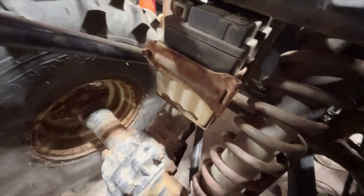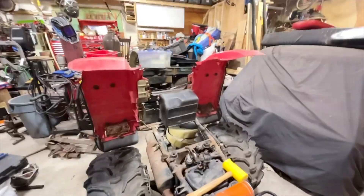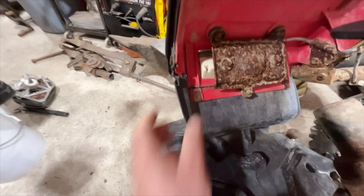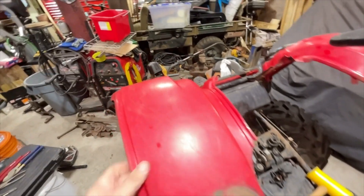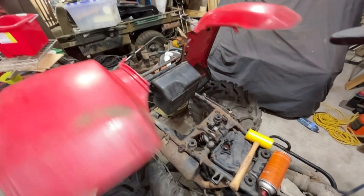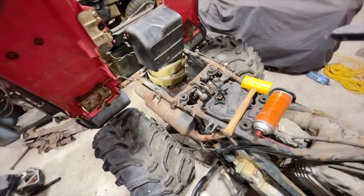Here's the battery section right here. First things first, what I'm gonna do — seeing as I don't need any parts to do it — I'm probably gonna take that off, that little piece, and clear it up. Now that I know this fender's got a rip in it right here and this fender's screwed right here, I think I am gonna save some money and order some new fenders. I'll keep those pieces, take the bolts out, try to take the bars off and clean them up — I can easily evaporust that. The bolts I can evaporust and redo them or get new ones.